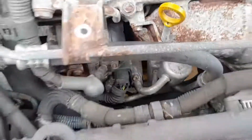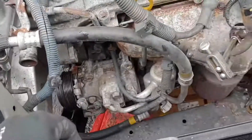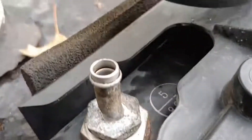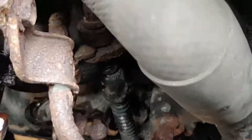This thing's pretty rotted all over. Next, remove the radiator. This was pretty difficult due to all the rot. I gotta replace all these clamps. The transmission cooler line — it was so corroded that one broke. This one is pretty beat up. I didn't want to disturb it too much. As you can see, the lower transmission cooler line is really bad. But now I have plenty of room to remove the AC compressor away from the bracket.